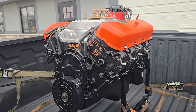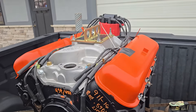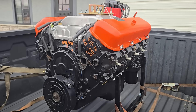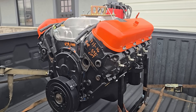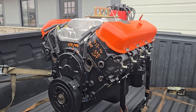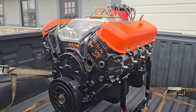So it's high torque. He wants it to run on 89 octane pump gas. I have a Brodix low profile dual plane intake on it because he does not run a cowl hood. It's a beautiful car. I don't usually have how-to videos on my channel, but I do spend about four minutes in this video showing you some of the procedures I did here in the shop.